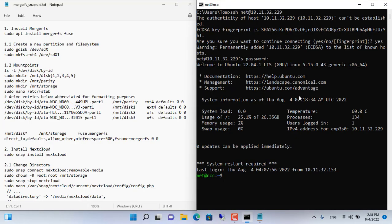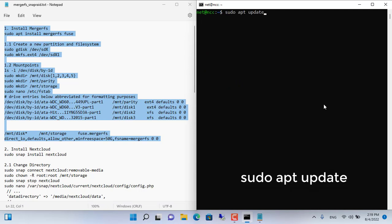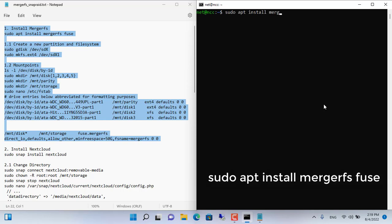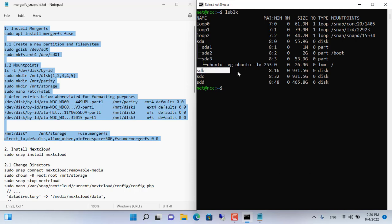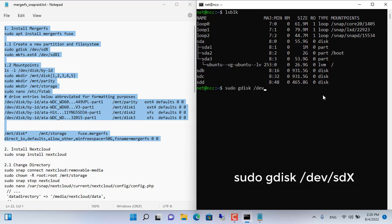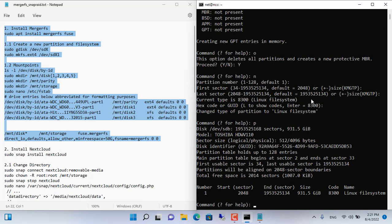In this part we will create an array of hard drives to merge them into one. You can merge hard drives of different capacities into one. Before merging the hard drives, update and upgrade your server. To merge multiple hard drives of different capacities into one I use MergerFS: sudo apt install mergerfs fuse. Let's review our four hard drives with the command lsblk. The SSD is used to install the operating system; the remaining three hard drives are sdb, sdc, and sdd. Since the hard drives are not partitioned yet, I will create a new partition for each drive, starting with sdb.